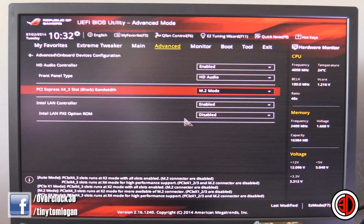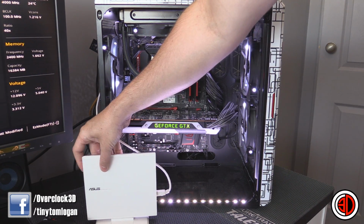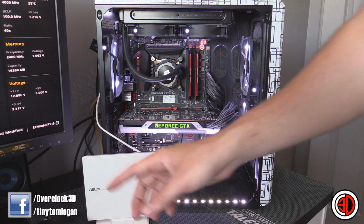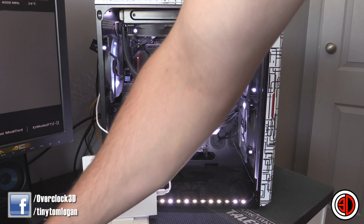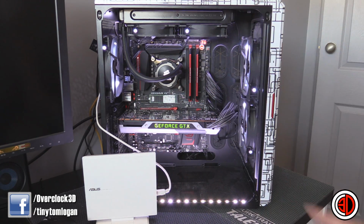And I'm going to show you both ways of how to get things working anyway. Okay, so if you're doing the Windows way, I've got my Windows disk in here. I'm clicking my drive close so it's ready to go, and then I'm going to hit F10. You can see I'm still in the BIOS. Hit F10 in the BIOS, and that will give me the option to save what I'm doing, and then the system is going to boot up from this, and I will show you what you do from the Windows disk side of things.